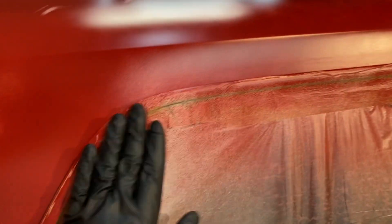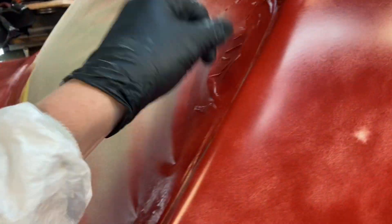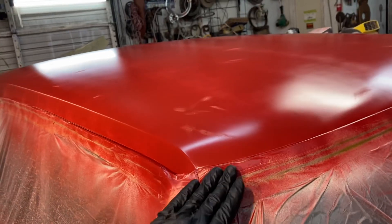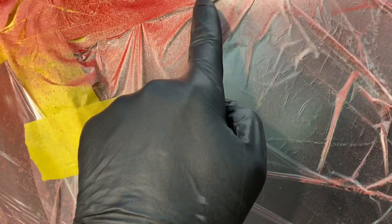My paint mentor Brian basically said if you're walking around feeling your tape, feel the tape that's on metal — like a piece of trim — versus the rubber, because the rubber has a different surface temperature than the metal does, and they'll tack at different temperatures. I'm nice and tacked off. This is a good 3M plastic that everything sticks to. I'm going to go ahead and shoot that other base, and I'll bring it back for clear.